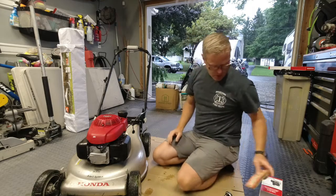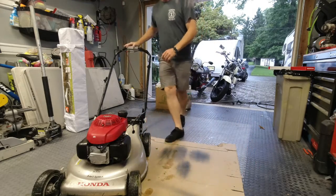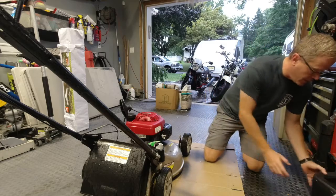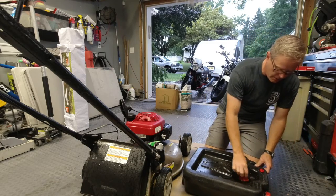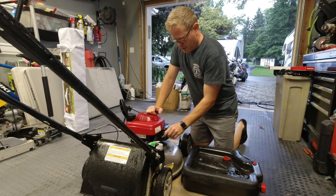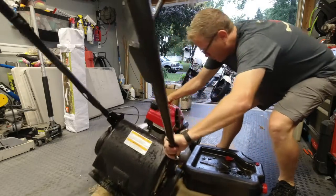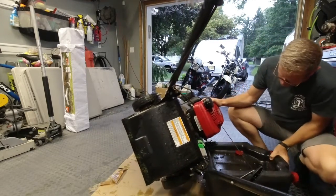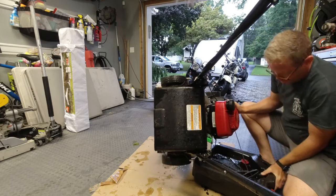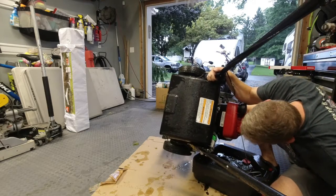The last thing is the oil change. It's really straightforward — it's not like a car where there's a plug. The oil change goes through the dipstick. I'm going to turn this around. Notice I have a piece of cardboard underneath because you could have some spillage. I have an oil catch container. Normally I'd have gloves on. You take the dipstick out, clean it, and then tip the mower over so the oil flows out into the corner of the bin.